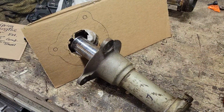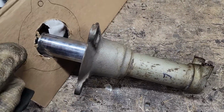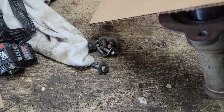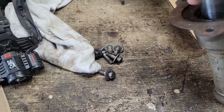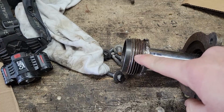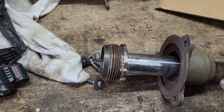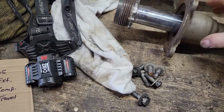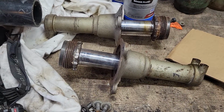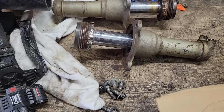I'm doing a little bit of CAD here, cardboard aided design. These are the old ride height adjustment cylinders. These run off of the car's hydraulic system. And basically that would screw into the cap on the top of the spring. And then they would give you that approximately 4 inches of height adjustment for ride height. Believe it or not, I think I can sell those used as they are for most of the cost of the air suspension that I'm doing.